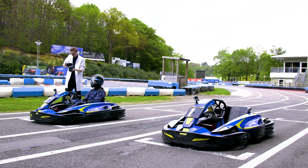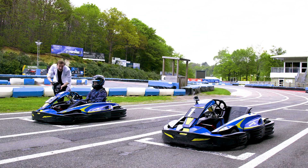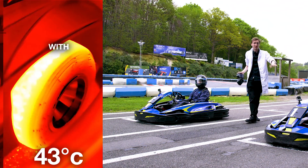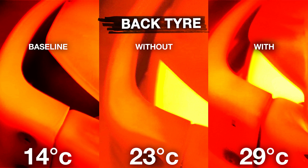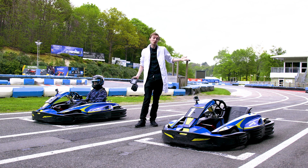In comes Chris — let's see what the fronts are. At the very front, we're up to 42 to 43 degrees, and at the rear we're up to 28, almost 29. So a massive difference between the first kart just doing a normal out-lap versus the zigzag approach generating more heat, therefore giving your tyres more grip, allowing you to control your kart even better, so you can just race even better.